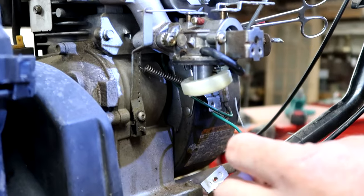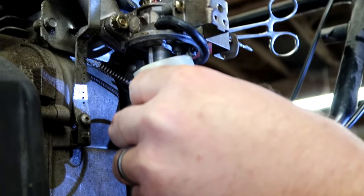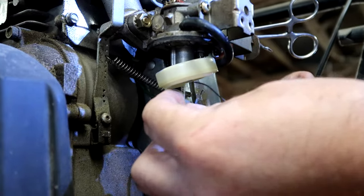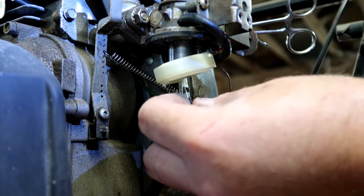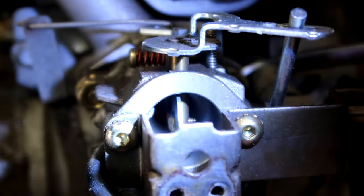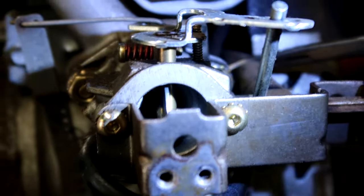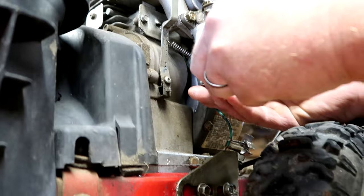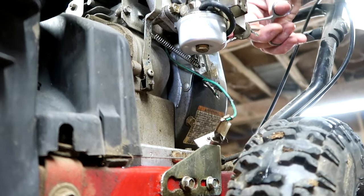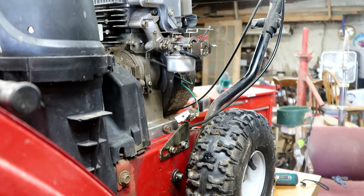The other thing I'm going to do is run this wire up through the bottom and just make sure that's all cleaned out. Sometimes there's debris, sometimes it's just gas that's gunked up. If you go all the way through, you'll see the little piece of metal going up and down, so I'm reasonably assured that it's clean. Just tighten this back up — not too tight. I release the fuel, and if there's no leaks, then we did it right.